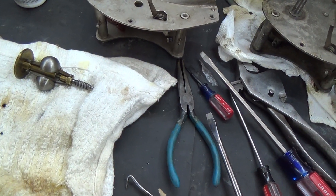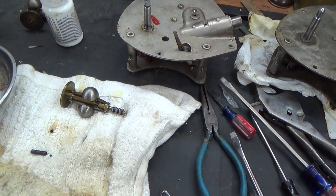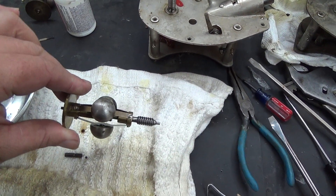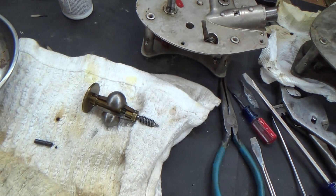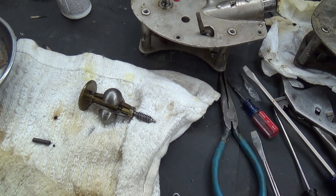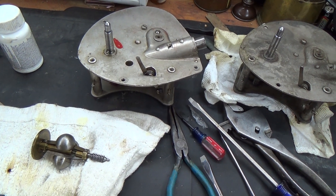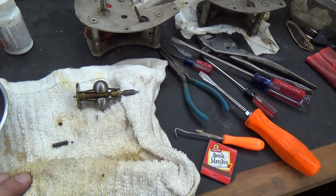It has to be done. Yes, it's time-consuming, and you do have to take the motor out — but it has to be done for a proper job. These bearings must be cleaned and lubricated. Extreme examples like this are why, when I see something like this that was absolutely not serviced, eventually that shaft and cup will start to wear and your governor will get cockeyed in the bearing. I've seen it — it causes a lot of noise and other damage. So lubricate it and clean it properly when you service the motor.